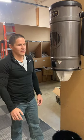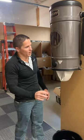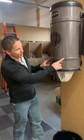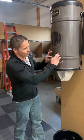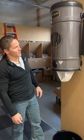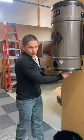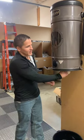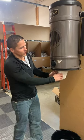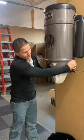To do that, it's a little tricky so I'm going to give you a couple of really important pointers. On the unit itself you'll see there's a bevel right here in the middle, about six inches up from the bottom of the canister. That is where the filter is snapped into place, and that prevents the filter from being pulled down. To get the filter out, put your hand on the inside and reach towards the back of the filter right at this bevel.